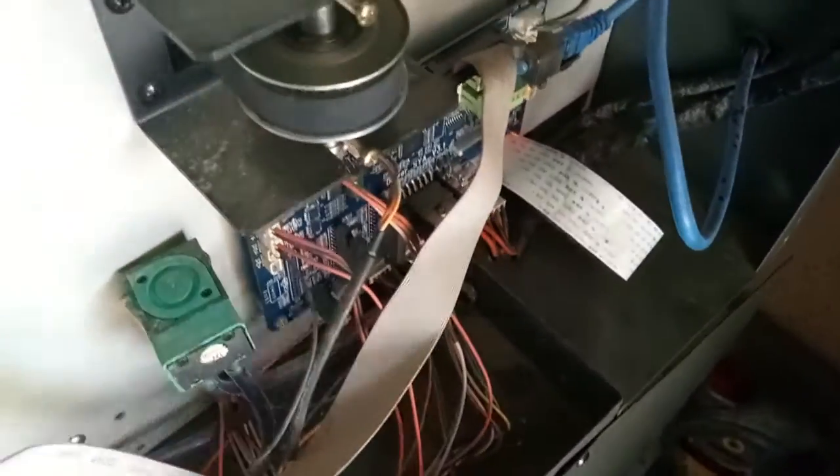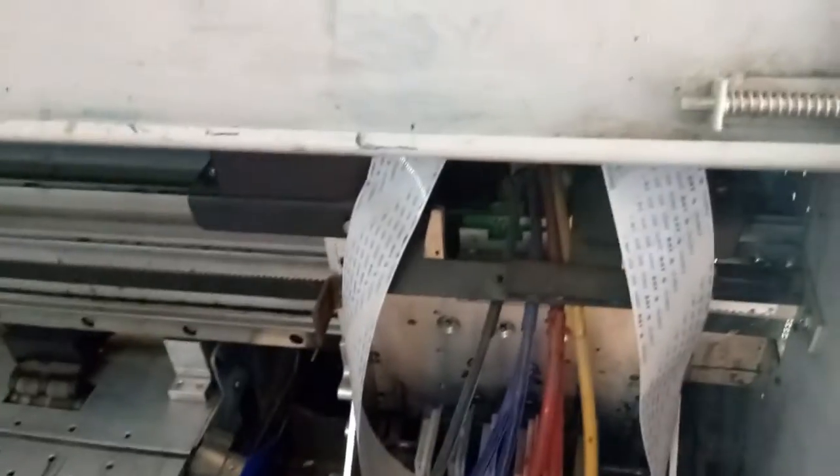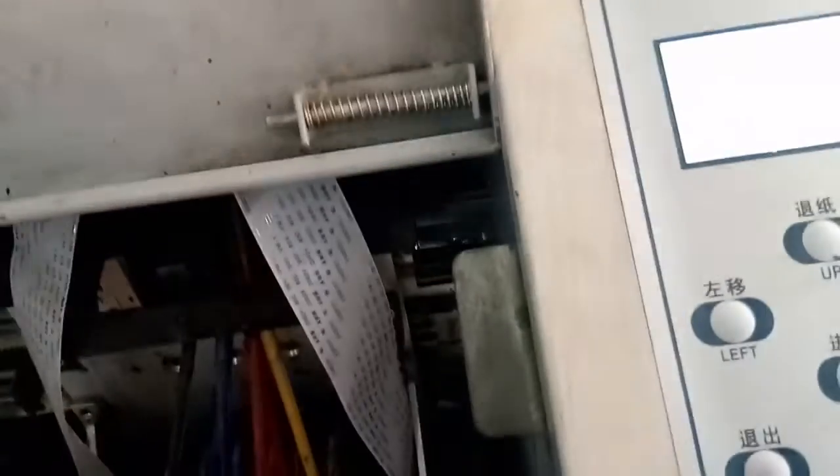The question is: how do you know which side of the cable to remove? The truth is you can't know right away, so you have to test this side first. If the error still persists, go back and test the other side. That's the only way to isolate which end of the cable is the problem.